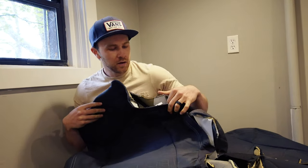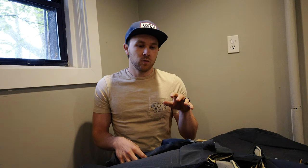I ran into a real dilemma — this needed to be sewed back together. The dealership uses a special thread and a special stitch pattern so that when the airbag deploys, it can split open and the airbag can go up against the door to protect you. If you don't use the right thread and stitch, the airbag might not deploy correctly, which could be really dangerous. So I had to get new seat covers. Buying from a dealership would be thousands of dollars in materials plus labor, but I found an upholstery shop in Florida that had recovered seats with leather from a truck just like mine — same color, same fabric — and I was able to buy a full set of seat covers for about $200.